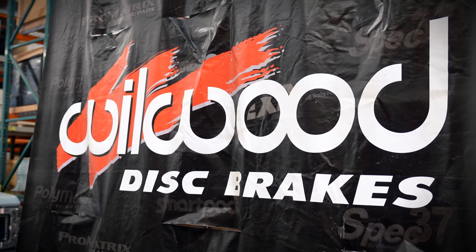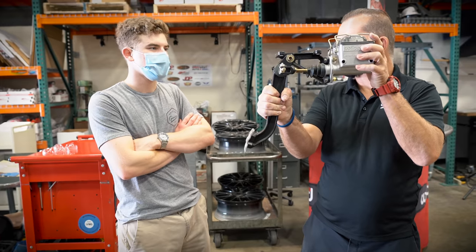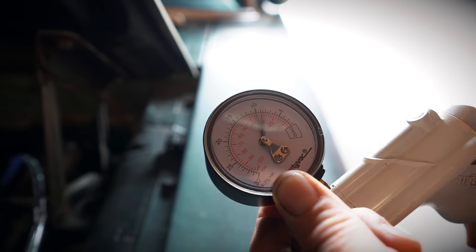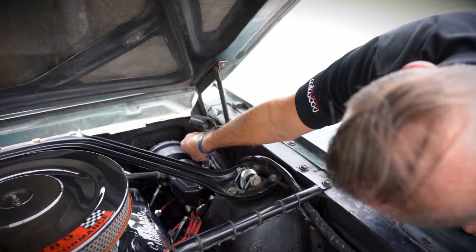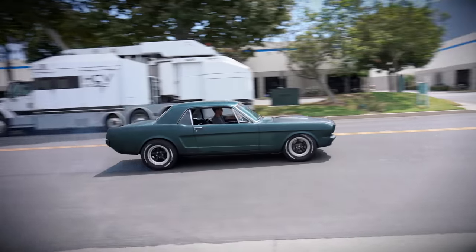Hey guys, my name is Ben Kan. I've been behind the camera pretty much this whole summer, but today we're converting my Mustang to manual brakes. I took my Mustang up to Willwood to see if I installed my brakes correctly — huge shoutout to Kyle and Mike at Willwood. Mike checked out my whole car, went through the brakes, and told me I installed them correctly. The only issue was my booster wasn't making any vacuum, so my brakes were worse than manual brakes. The proportion valve was also out of tune, so he helped me adjust it and suggested I convert to manual brakes.